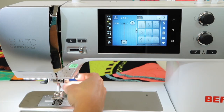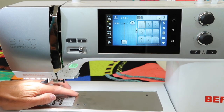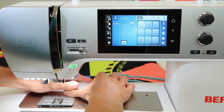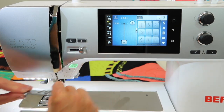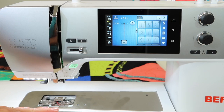I've already removed the needle, so I'm going to go ahead and take the foot off and then remove the throat plate. If you notice in the back corner here, there's a little bullseye. If you take your thumb and press down on it firmly with your second thumb — that's how I do it — that will bring the front edge up. I still have my bobbin in, and you can do this without having to remove anything from down below.